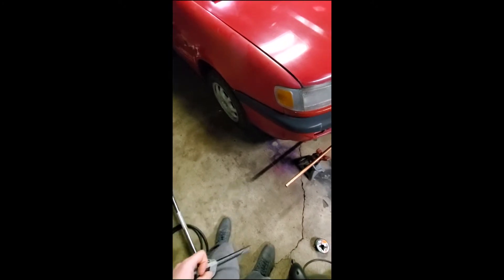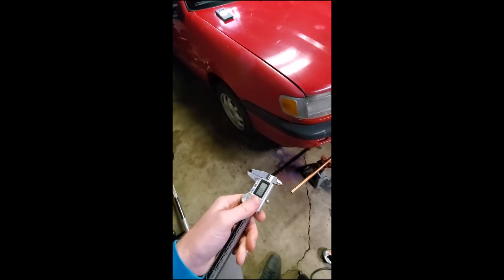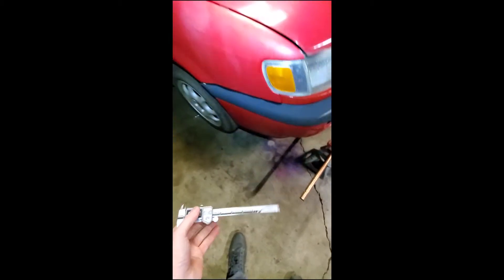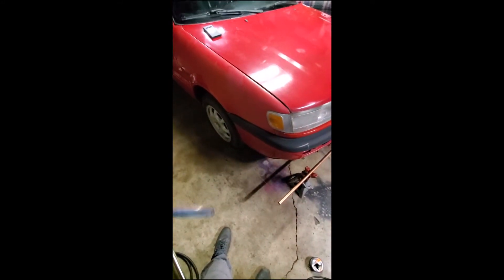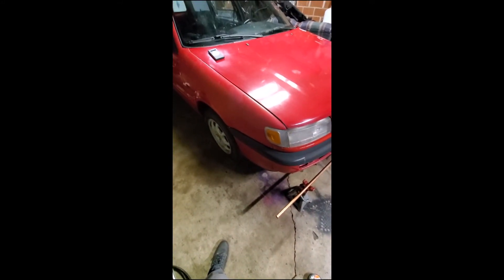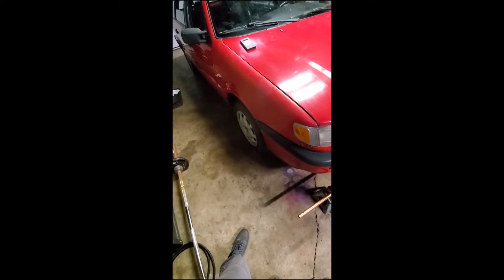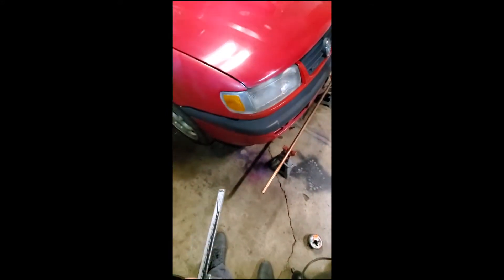What we've got to do first is build a jig. The theory behind it is we want to build a box where we have some reference point to measure off of, which would be fishing string right here. We want the fishing string parallel to the travel path of the car, which means we have to box the car, make the string equidistant to the rims, and make it parallel to the travel path. And the way we do that is we make a jig.